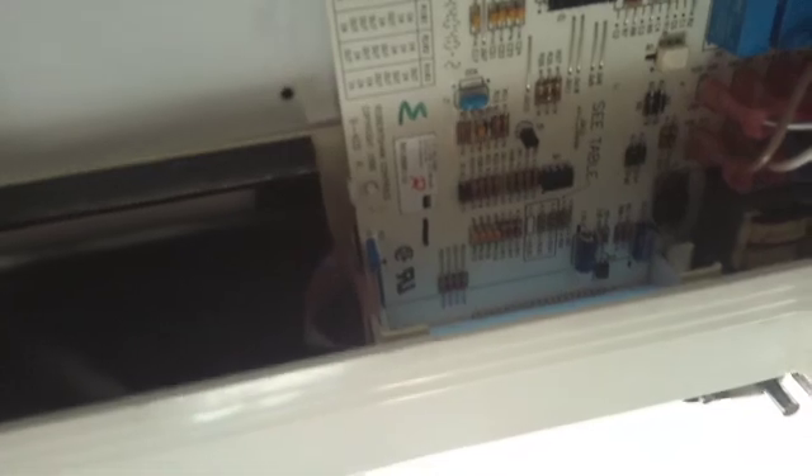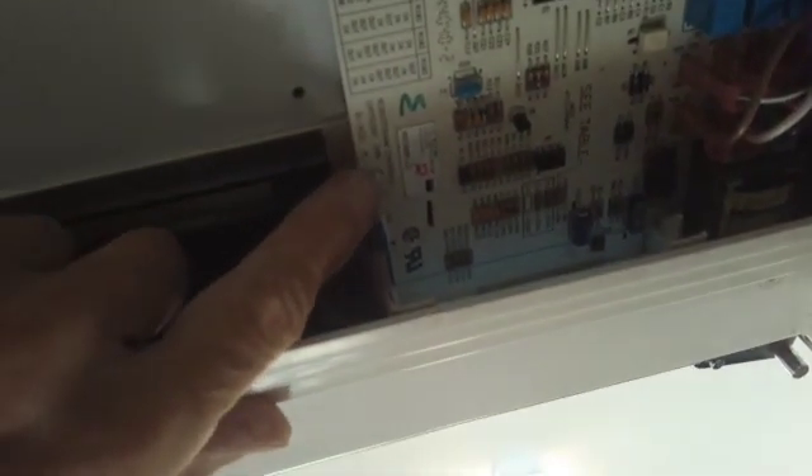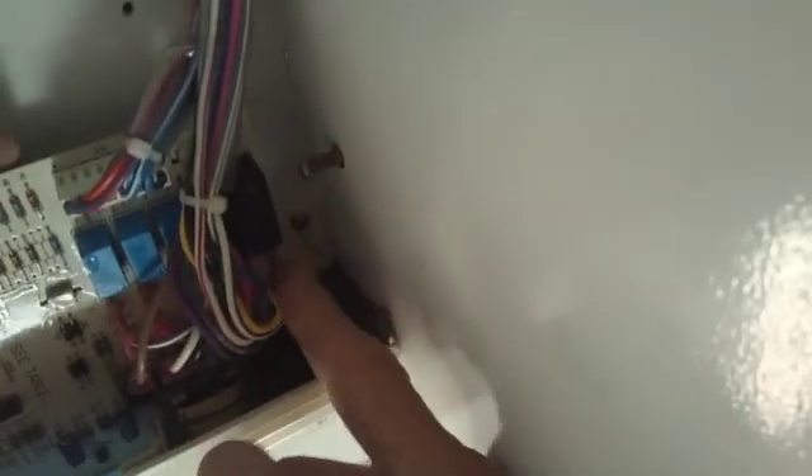So there's your computer board. There are a couple of plastic clips — there's one here and one on the other side. You have to kind of push out with your finger and pull these clips. Hold it up — it snaps into place like that. So you pull that down, pull it back that way, away.